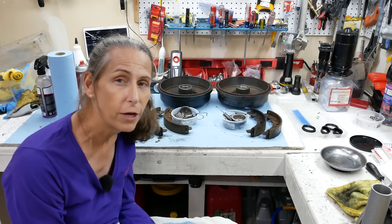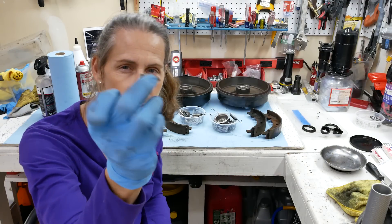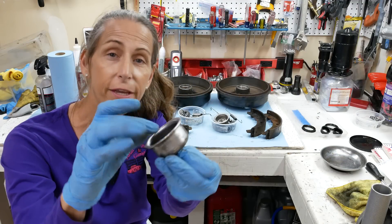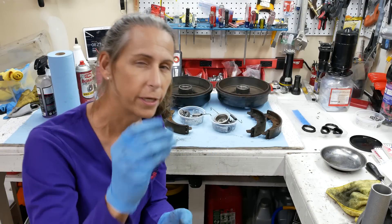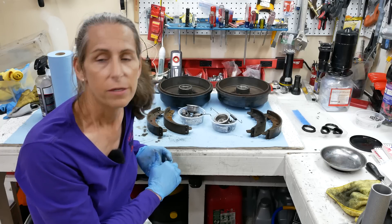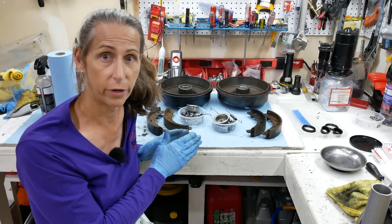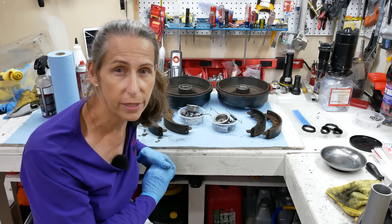There was one other casualty. The owner Jerry mentioned the speedometer stopped working a while ago — and that would be this little drive dog that goes inside the cap, held on by a circlip. It obviously snapped, so we need a new speedometer cable as well. That's pretty much it for the front brakes. The rear brakes are a pain to take off with those big castle nuts and a gazillion foot-pounds of torque, so we're going to wait on the rears until we get the fronts sorted.